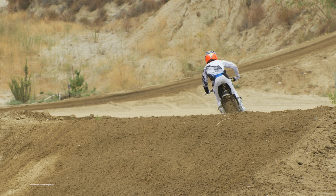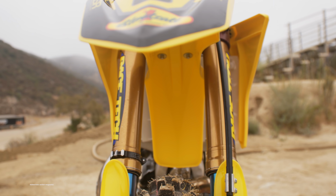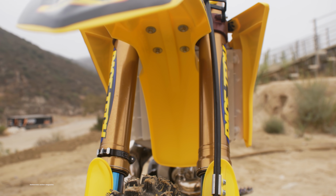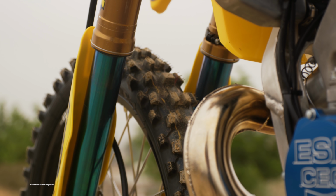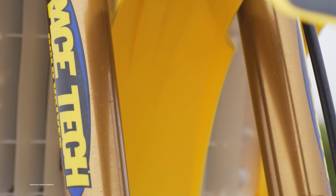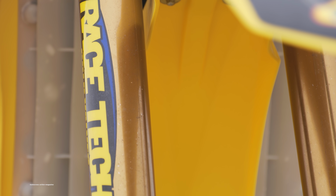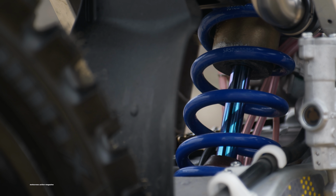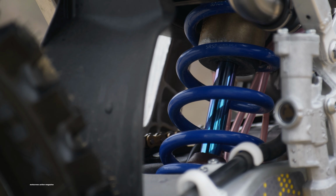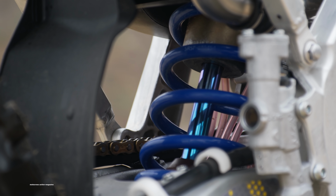On the track, the suspension worked like a dream for the MXA test riders. We didn't have to adjust any clickers, and Mike Alessi's sag actually worked perfect for our pro level test riders. One word that came to mind while hitting bumps and landing from jumps was predictable. The best bike is the one that works naturally and doesn't require a special technique to go fast on. In short, it does what it's supposed to without any surprises. And that's how we felt about Mike's ultra rare Showa A-kit Yamaha forks and stock YZ250 shock tuned by Racetech.